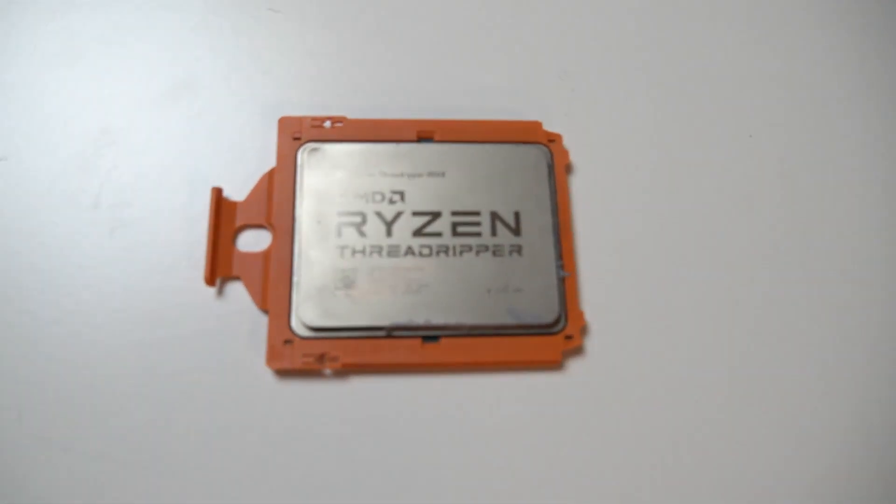Let's go over our parts list. As you know, I do a bunch of high-end desktop reviews, so in order to give my local church a proper workstation, we're going to be giving them one of my old first-gen AMD Threadripper machines. This is going to be the 1950X — it's a 16-core, 32-thread processor. It's a beast of a processor and it will literally chew through threads. One of the reasons I want to use that processor instead of some consumer-grade ones is all the PCIe lanes, quad-channel memory, and of course all those threads.